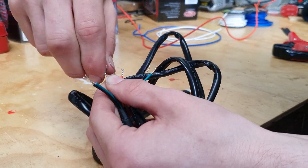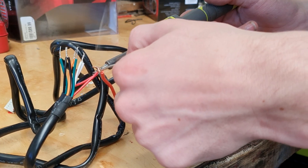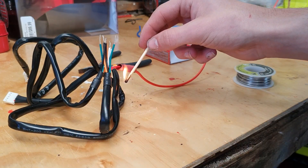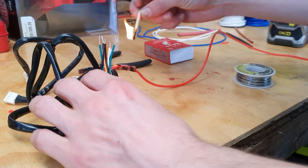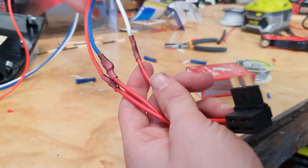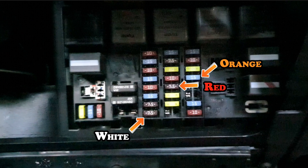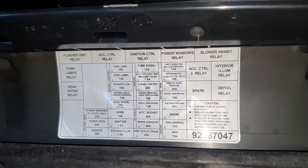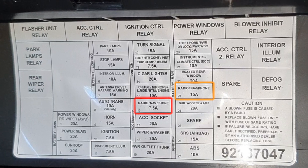The gauge wiring looms can be connected together — red to red, orange to orange, white to white, black to black. The red, orange and white wires can all be connected to a longer wire, and the ends of those wires will need to be connected to a fuse tap. Looking at the fuse box under the steering wheel, we can find the fuses we're after. We need a constant 12 volt, a 12 volt turned by accessory, and a fuse for the lights. If your car is nice it will include a diagram for what each fuse does — I'm using fuse 23, fuse 16 and fuse 11.